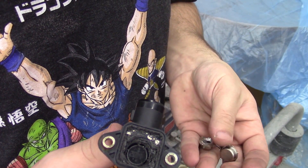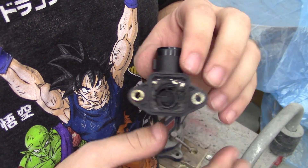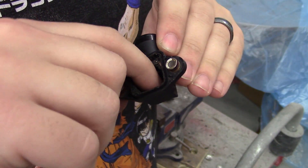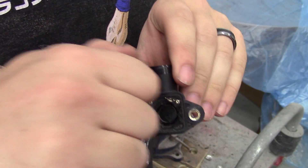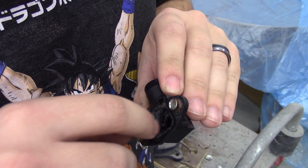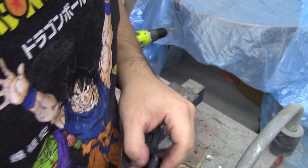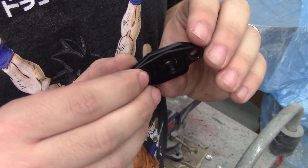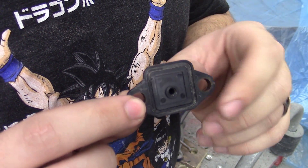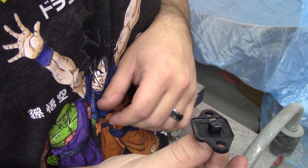You'll come down to a little piece that has two fins on it. Just drill down into it with that 27/64th bit. Keep drilling, and once you get down quite a ways, you can pry out that whole piece and you'll be left with this. Clean out the rest of the rubber silicone stuff in there, clean up these contacts, and then you're ready to go. One other thing you'll need to do is on the top piece, take your 1/8th drill bit and drill out that hole. That'll give you room for the new sensor to fit in, because it doesn't fit in the stock size hole.